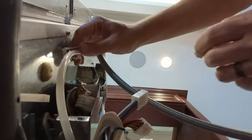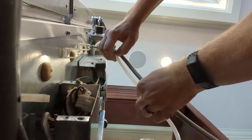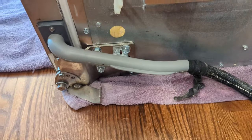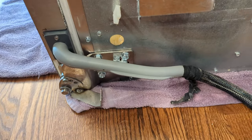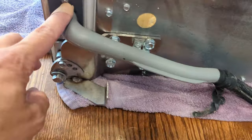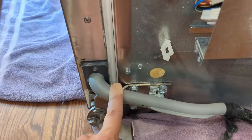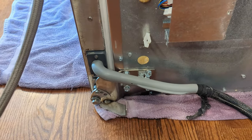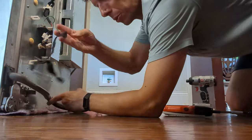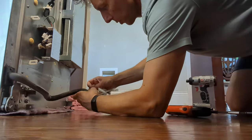Not bad at all. And then this water line comes out pretty easy. The blue end of this pushes in, and the hose pops right out. So now that this pipe is free of the feet that hold up the refrigerator, I'm gonna take the tape off of this and this, and then pull these two screws out. And yeah, hopefully be able to pull this out from the freezer. Seems to be some sort of...